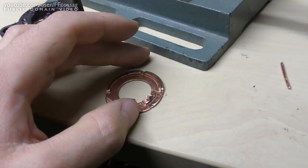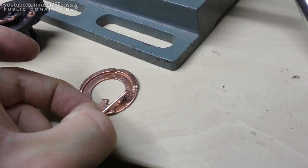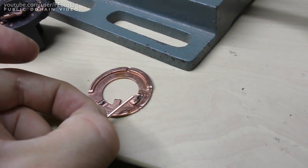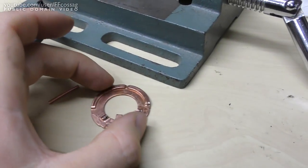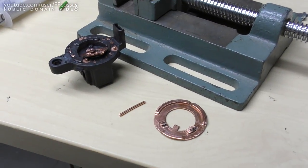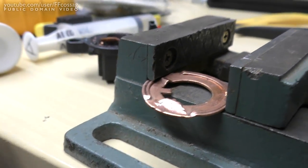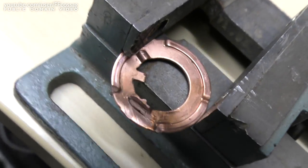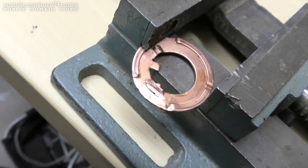The way I'm going to do that is grind away the damaged piece and solder in a piece of copper wire instead, then grind that down to fit the profile. It's going to be ugly and not very reliable, but the car just needs to last about a week. Right there you can see I've ground off the ruined part, so now I'm just going to solder in the copper wire, grind it down, and we'll be done.